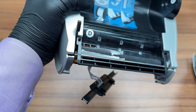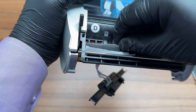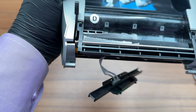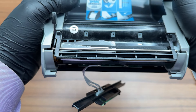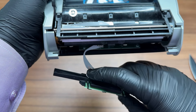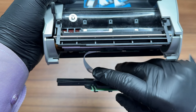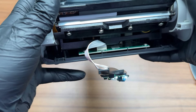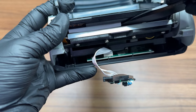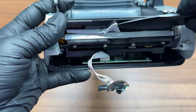You can divide the label into smaller sections or remove portions of it to reduce the number of layers. Once you have split the label, you can try to remove it from the printer. Use the release lever to loosen the grip from the printhead. If the label remains stuck, try using the feed button, which may allow you to remove the jam from the label dispensing area. While maintaining pressure on the release lever, use tweezers or your sharp tool to easily remove the label.